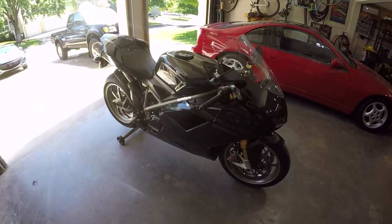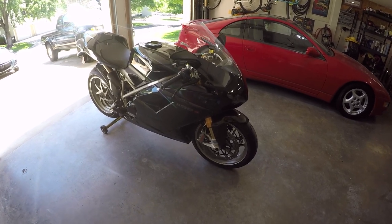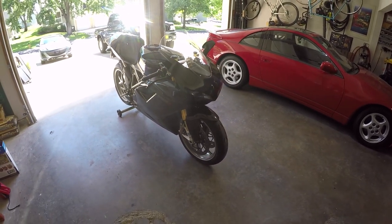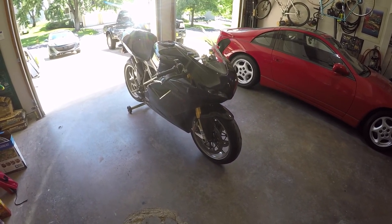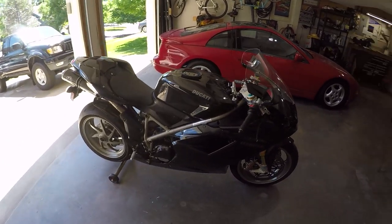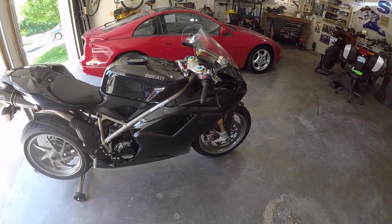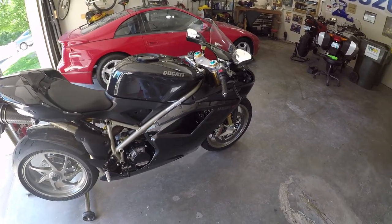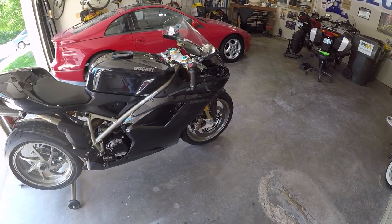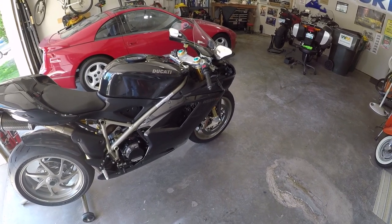Now, I would love to go out and ride this and get it on video on how it performs, but in fact, I've actually already done that, and another problem has cropped up that I need to fix before I can really go shoot a video with this bike. And that is the voltage regulator. Unfortunately, I was out riding, it threw an error, said battery voltage low with a 5.1 error or something like that. And after a little bit of research, it turns out the voltage regulators are definitely an Achilles heel on these bikes. So I'm going to replace that with a MOSFET regulator and relocate it so it's not right up against the exhaust manifold anymore. So we will do that in the next video.